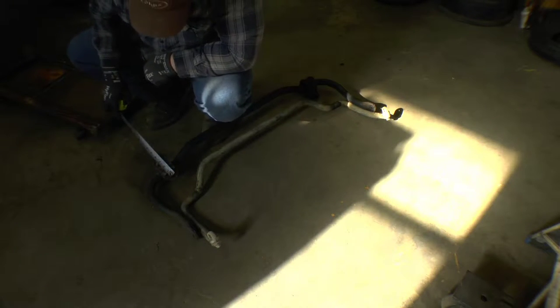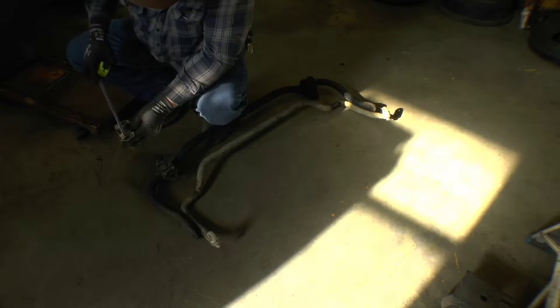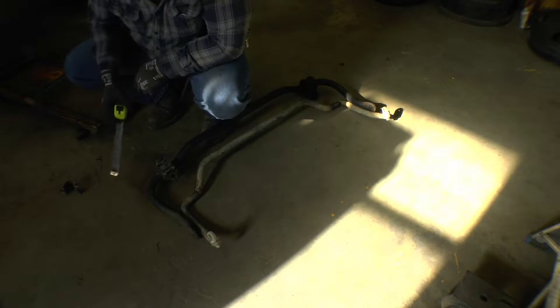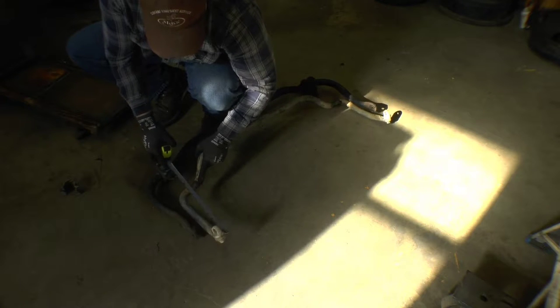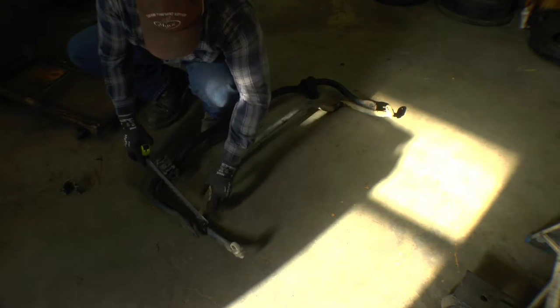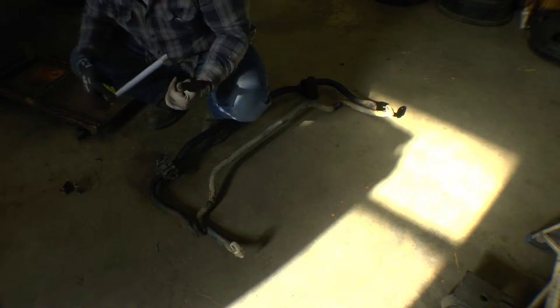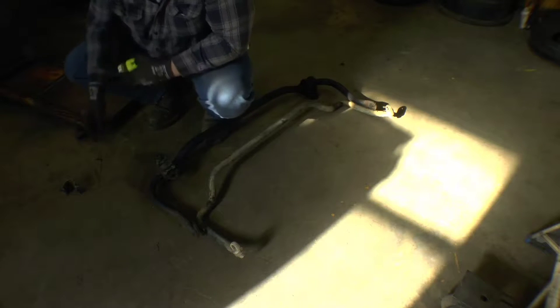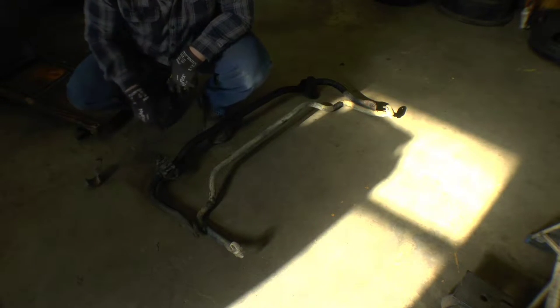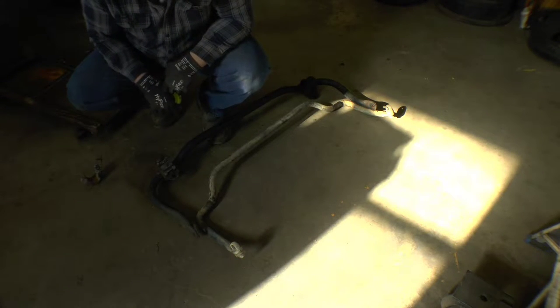Your hole center to center is about three and three-quarter inches on the XJ, and this one is about two and three-quarter. And from your mounting location to where your link attaches is about nine and three-eighths on the XJ, and on this one it's about 12 inches. So this is going to have to mount further away from the front axle, which means the one hole we had on this side where the bolt broke off - we weren't going to be able to use that one anyway. I'll probably step back and use the rear mounting hole as the front mounting hole for this one. We'll mock this up and see where this hole lands.